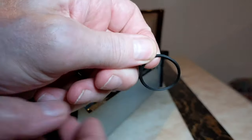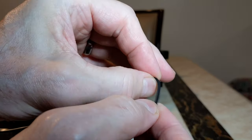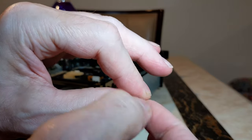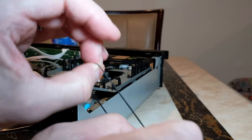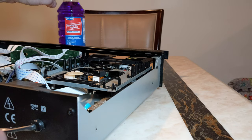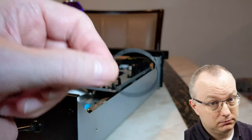This is the old O-ring — it's a little bit thicker but there's just no grip in it at all. I can pull it through my fingers and it slides straight through, it's so smooth. The new one, even though it's thinner, has a lot more grip — it's very hard to pull through my finger. They're pretty strong, I don't think that's going to snap anytime soon. I've also got some methylated spirits to clean the rollers, then I'll try to get it on.